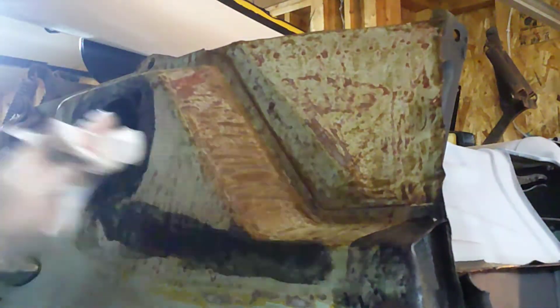It's rolling up a little, there are divots just where it hadn't cured all the way, but this one looks pretty okay. There were some spots where it ran really thin and didn't actually bond to both sides of the surface, so there are those little pinholes — kind of looks like vampire fangs in there, somebody looking at you — but I think it turned out pretty okay. I'm leaving a lot of these imperfections because this truck has lived a lot of life, and as long as I can fix a lot of the rust holes and it's comfortable and will inhibit some of that rust in the future, I'm pretty okay with that.